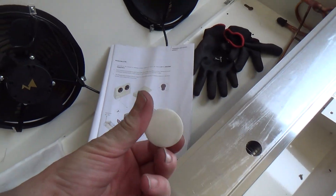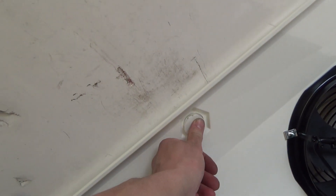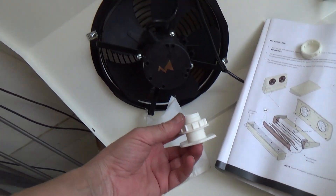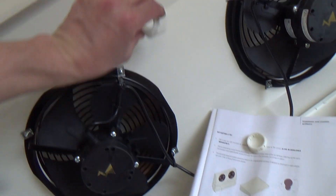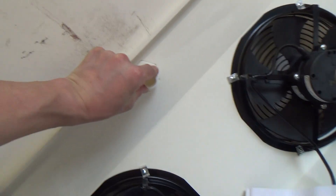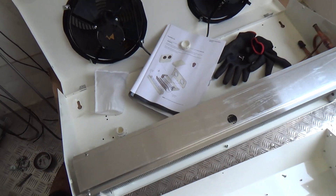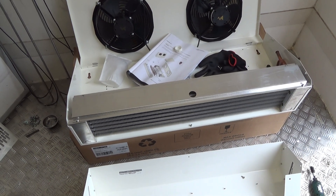There's a blanking plug and I don't know whether they've gone metric or imperial, but it comes in there — you take it out and you're supposed to put it in there, but it doesn't stay. We'll have to try and glue that in. Luckily the drain fitting supplied with the evaporator will actually fit in there with a rubber O-ring, so that might work. I don't know whether they've changed the size — I know the bigger ones they've started putting bigger drain fittings on, which is a pain.